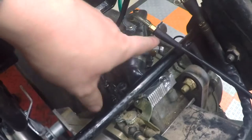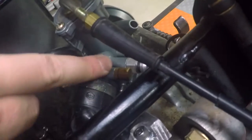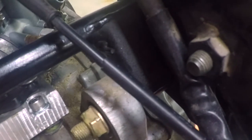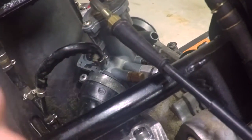The hard part was the carburetor. There isn't really anything on the market aside from a super expensive Chinese knockoff carburetor kit. Usually the intake manifold comes out this way, and it's made from straight cast aluminum. The kit you can buy is about 20 millimeters of a carb and it just seems off. So what I did — I bought this piece of aluminum, I Dremeled it open to have a Venturi from this Piaggio intake that I had laying around, to the reed valves of the Kymco, which I opened a little bit too.